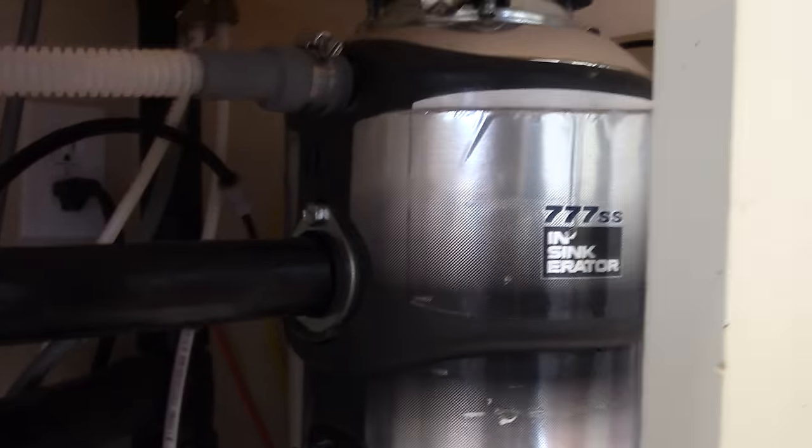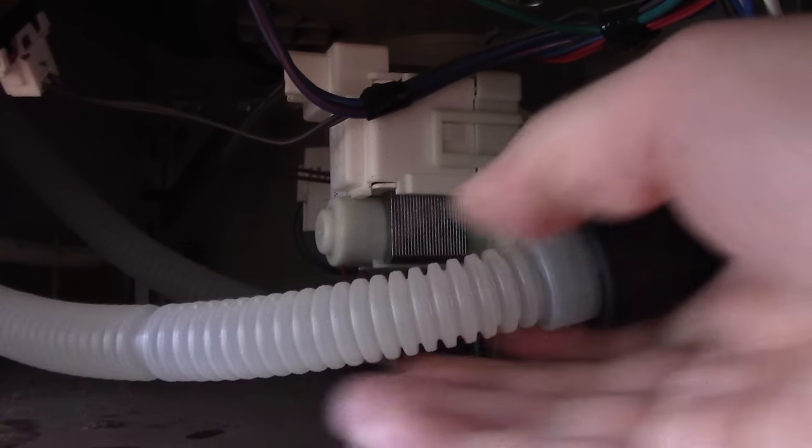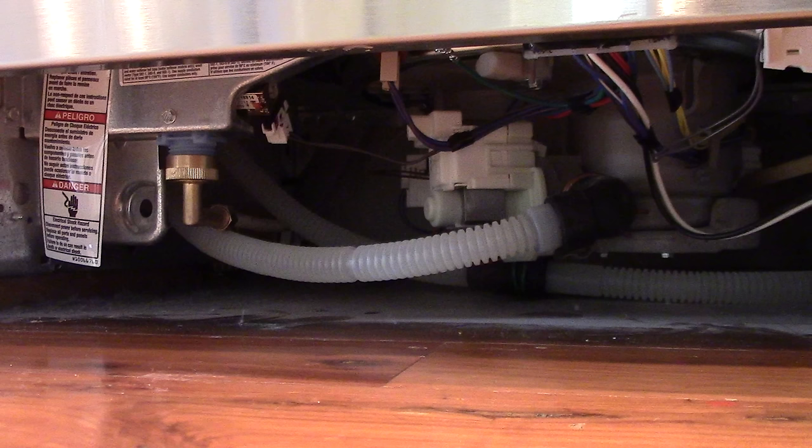It is possible that this hose could be clogged at the garbage disposal end or at this end, so you want to look and make sure that there's nothing blocking it inside. Now before you mess around down here with anything electrical, you do want to turn off the power to your dishwasher. Chances are it's hardwired, so you're going to need to go to your breaker box and flip the breaker switch. If you want to check to see if your drain pump is blocked by a piece of glass or a sticker, but you don't want to take your whole dishwasher out, you can disconnect this hose right here by pinching these two metal clips together and releasing this rubber black elbow. But it will spill out water, so before you do that, try to use a sponge or towels and soak up as much water in this part as you can — that way it won't flood out and spill all over your floor.